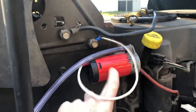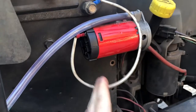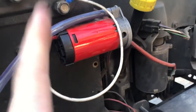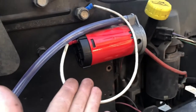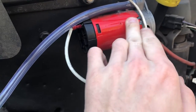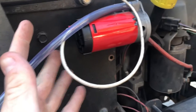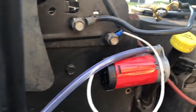Something to note about these horns — and pretty much any electric air horn — if you wire it up backwards it will still work, but it'll sound dull and won't work right. If you switch the polarity it'll actually blow properly. Basically the fan spins the opposite direction and blows air the wrong way instead of out into the hose.